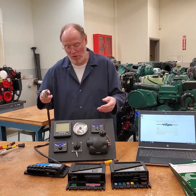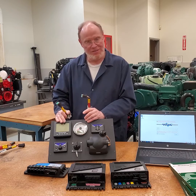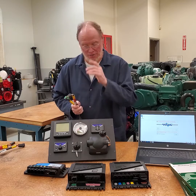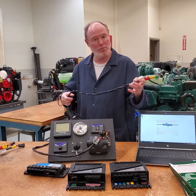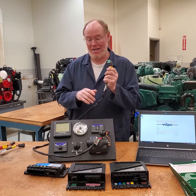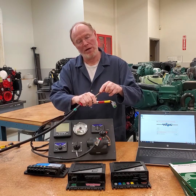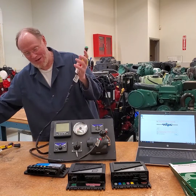Everything else is plug and play. We have a TAC, we have an LCD, and we have two different cables both plugged in here. If you have a multi-function display — an LCD display that's bigger, seven-inch or so — it may have its own separate harness from the factory; don't forget you need that cable. The multi-link extension harness for the sync cable is basically a male-male six-pin harness — very different than an X2 Datalink harness. It has the same exact end as an X2 Datalink harness but has two separate CAN lines in it. The X2 Datalink only has a twisted wire pair — only one set of CAN lines. So you can't ever try to use one for the other; you have to have the right cable.